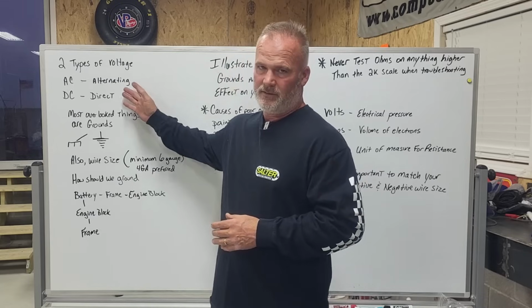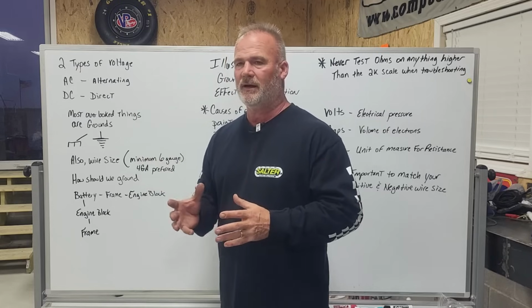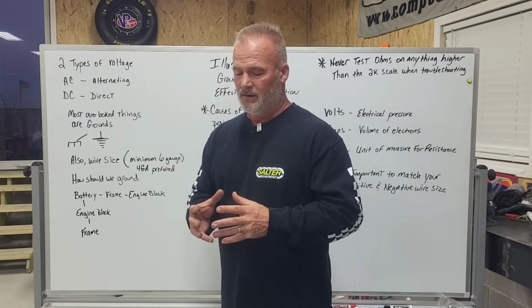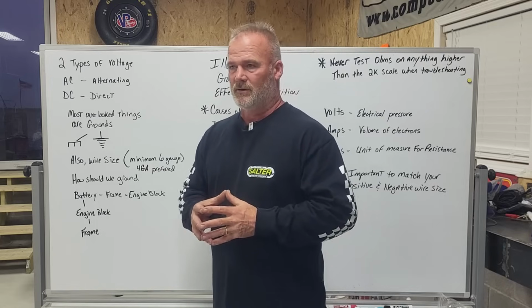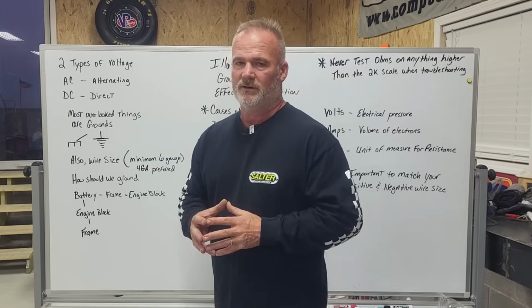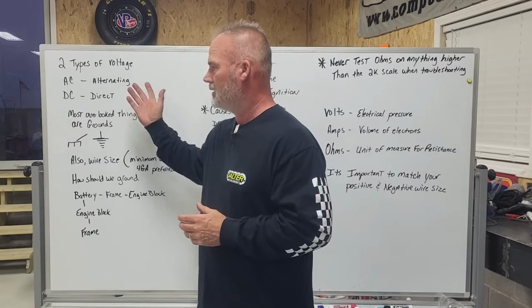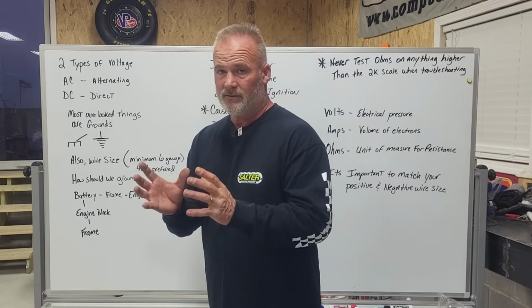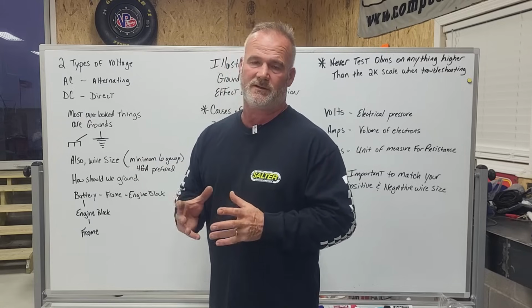When do we use alternating current? See, direct current is created chemically, okay? In a battery, it's chemically created. Alternating current, however, is created by magnets. So in order to create a voltage, you must move a conductor through a magnetic field, all right? Well, that's alternating current. We have an alternator on the car, and the other alternating current is the voltage that comes out of the coil.